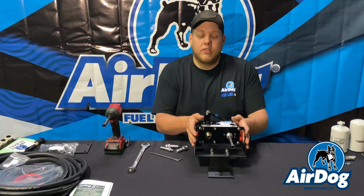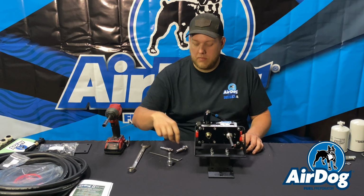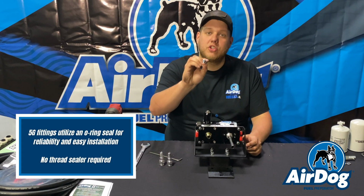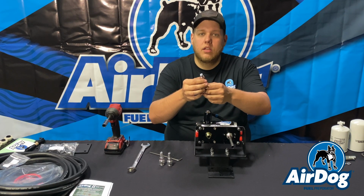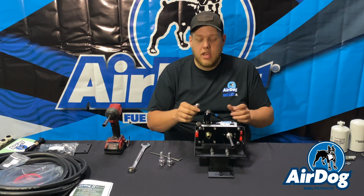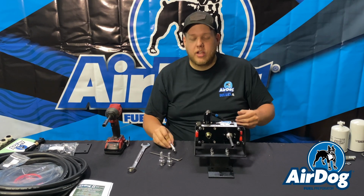So to make it a little bit easier, we're going to go ahead and install our Airdog Quick Connect fittings into the base. You're going to have two larger 3/4 UNFs. Then on the 5G, we upgraded this to a 7/16 UNF. I believe that is going to be a -3. I apologize, -4. So if a customer ever did want to convert to AN, it is easily adaptable with this new 5G unit, and larger, so you don't have to worry about breaking it.